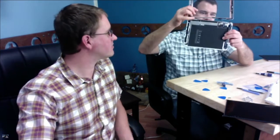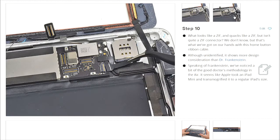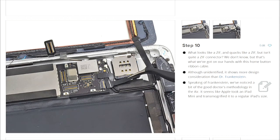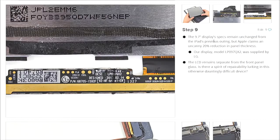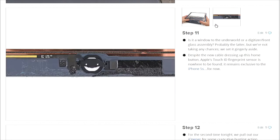Okay, so the front glass and digitizer is actually held in place originally with the glue, but now there are three cables, and I just managed to free all three of them. And those are attached to the main board? Yeah, exactly. So they're not glued in, are they just plugged in and you just have to pry them loose? Yeah, they're actually plugged in. One of them has a little toggle switch that you have to first flip up before you can remove it. But then the other two, with just a little quick twist of either a spudger or one of these pry tools, it'll come right off. Right now, all the cables are loose, but this is still the remnants of the glue holding it in place. So yeah, just have to, there you go.